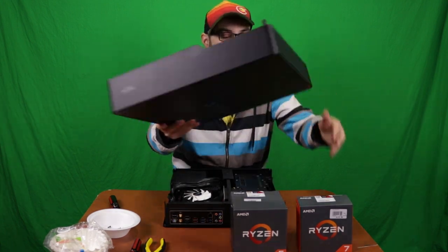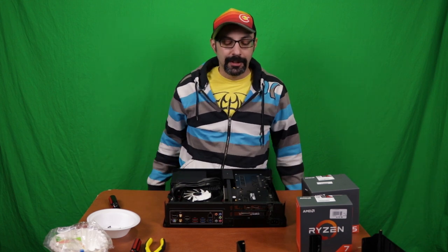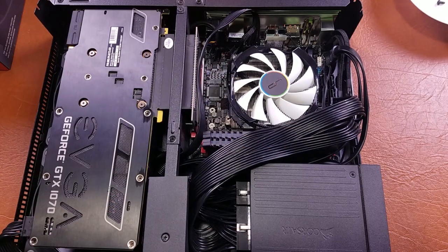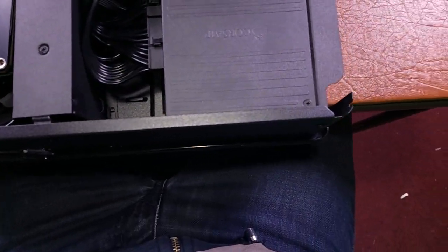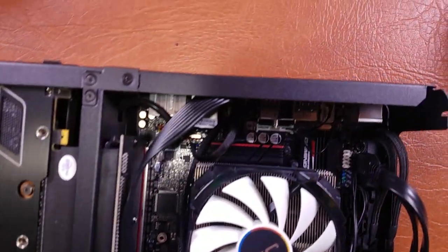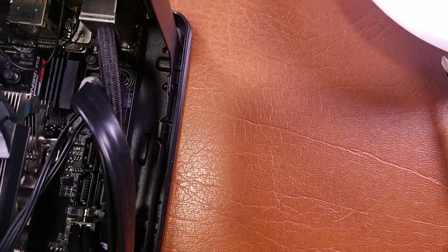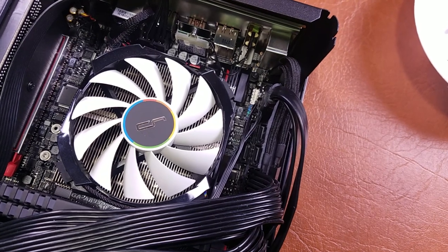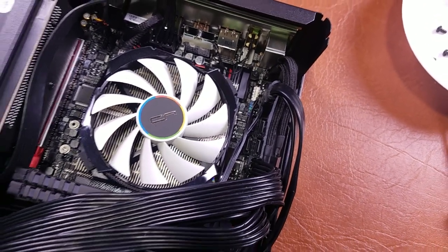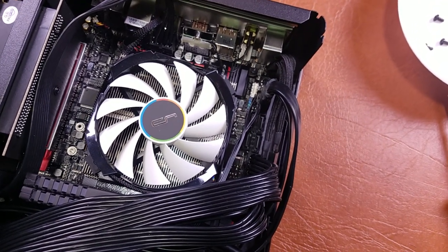Fortunately the panel comes right off, which is nice. I'm going to use my phone to show you what's going on inside. There are these little tabs on the inside that are a little difficult to remove — you've got to kind of work this back cover off to get to the brace that goes behind the cooler. I'm going to time-lapse this step. All we're doing is removing the cooler, getting to the back of it, then removing the CPU and replacing the thermal paste.